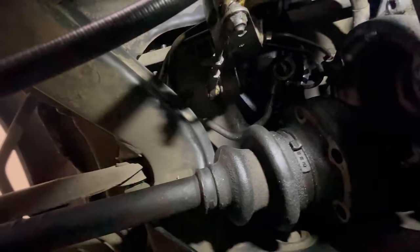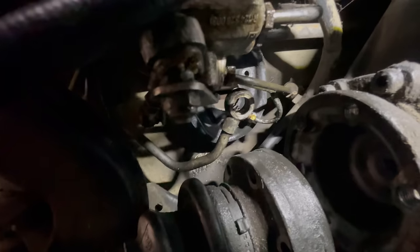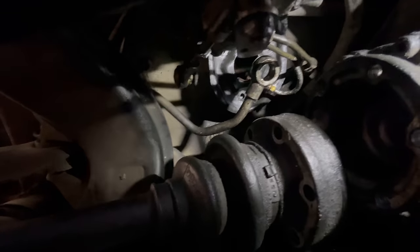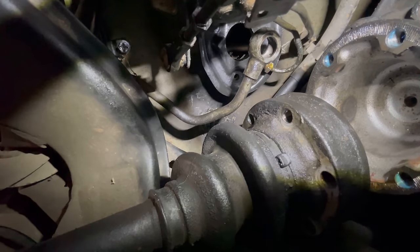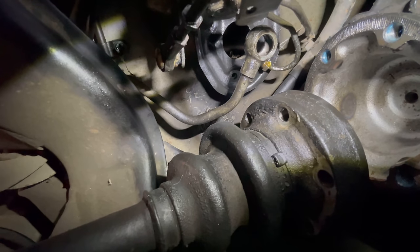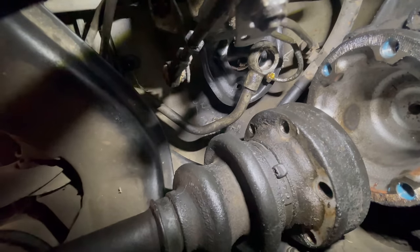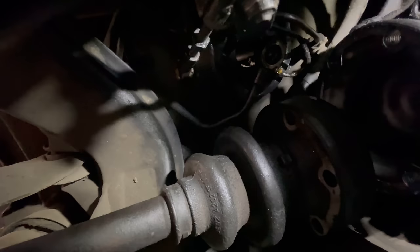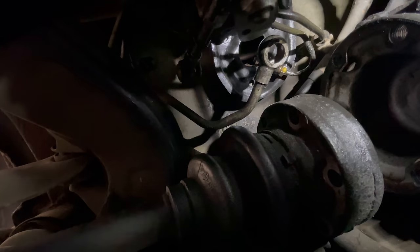And the offending unit, come on, Mike, I want to get up here, but I don't want to get covered in oil already, because I've had to wash my clothes several times. Okay, that little brake line connector right there, I can't get it in. I've tried and tried and tried. The problem is the line into the valve system right here is so short, and it's a steel line, and there's no give and take.